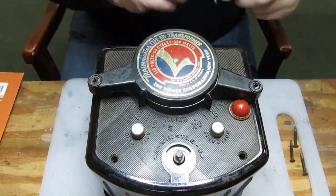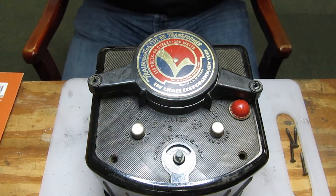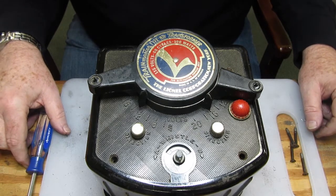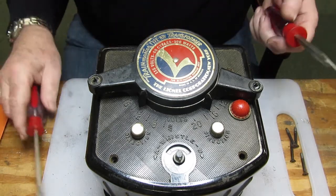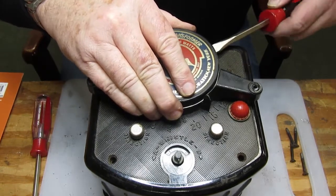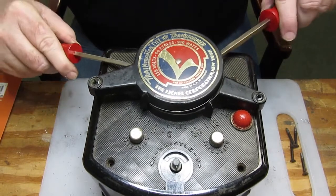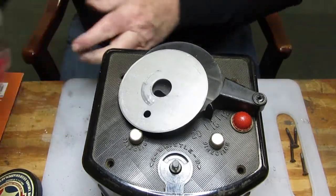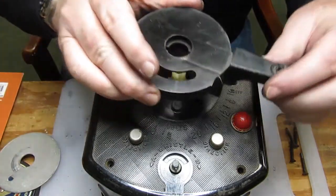For the KWs, replacing the cord is a major thing to do and it's a real pain in the neck, but absolutely essential. So we're going to have to just grin and bear it and do it. Once you know how to do it, you'll just take your time and get it done. To avoid breaking all the handles — these we're going to replace anyway — I usually use two different screwdrivers at different places to gently pry up a bit. And then it just pops off, along with the metal spacer.